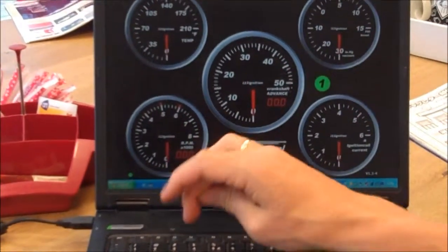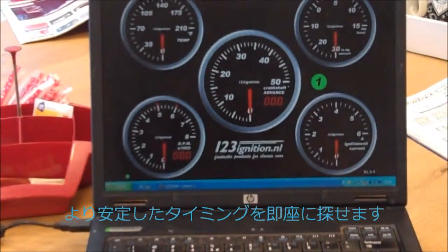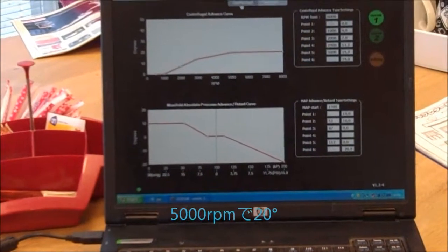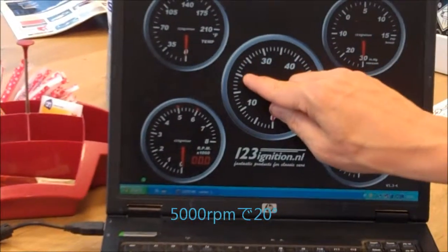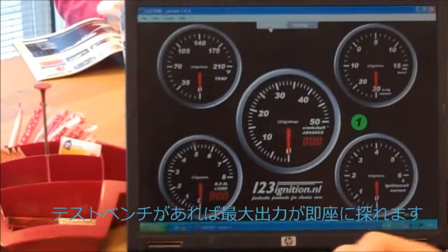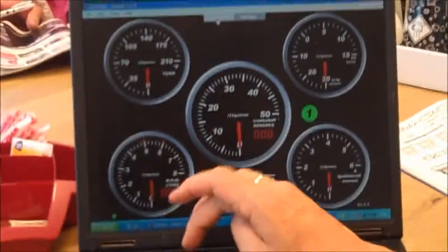Now, by doing this you can find out, hey, it's much nicer now — advance or retard. It's a maximum of plus five degrees or minus five degrees. For instance, if this would have 20 degrees at 5000 RPM, at 5000 RPM it would show 20 degrees, but with advance and retard I could go to 25 or 15. This is a nice approach if you have the engine on a test bench, on a large machine where you can measure the power — then you can immediately see: I need 3.6 degrees extra for optimum power.